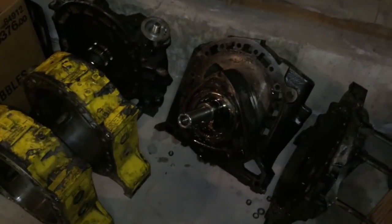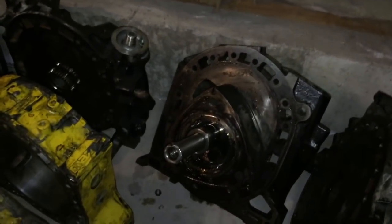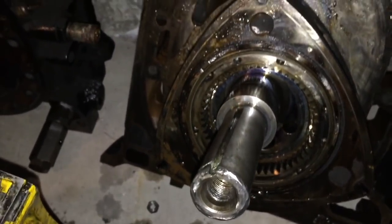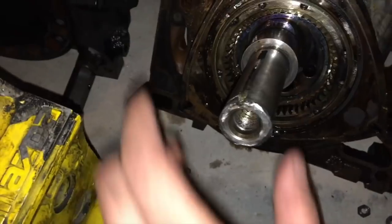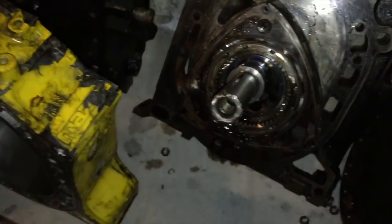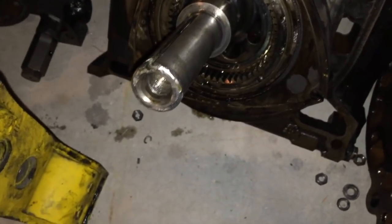A couple things didn't go as planned. One, my battery died during the time-lapse of the engine disassembly so I didn't get to record the rest of that, which kind of sucks. And two, during the engine disassembly — let's go show you. Here is my engine, all disassembled. A little bit of good news and a little bit of bad news. The bad news is my front rotor is locked to the e-shaft. It turns out it was the front rotor bearing that seized and caused my engine to lock while I was driving. What that means is I can't get it out of the center iron because the rotor can't move. So I'm going to have to clamp this e-shaft down on a vise — it's not reusable anyway, I kind of messed up this front part, but I wasn't going to reuse it anyway. I'll have to find a way to move this rotor a little bit forward.